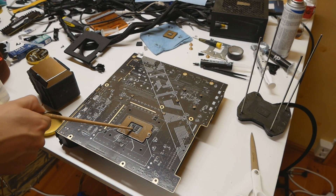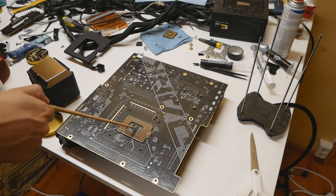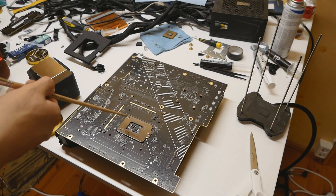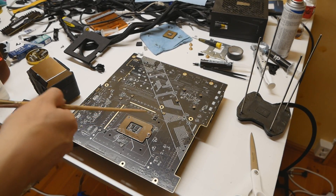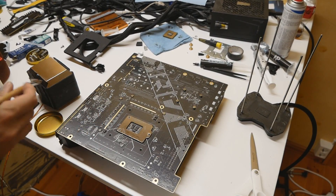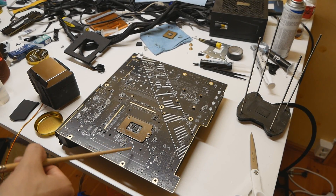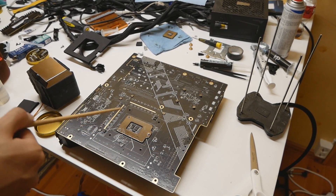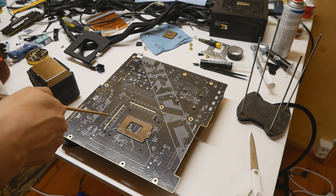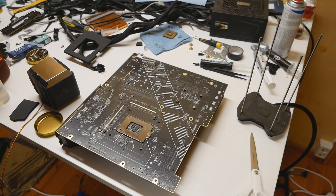Be aware that on the EVGA Dark boards there's a small hole at the center of the back side of the socket. Do not put too much Vaseline here because when you push the Inferno backplate it can push Vaseline into the socket. You really don't need much here anyway — it doesn't matter if we have water on top of the PCB solder mask itself, we just don't want water shorting any components to ground.